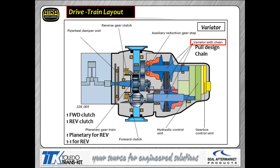To get the variator assembly out, you have two options: either take a couple of links out of the chain — which is what Audi recommends — remove the chain, then take pieces out one at a time; or press the pinion shaft out using a porta-power to get it out. The pinion shaft is pressed in place. On the right side you see the TCM in bright yellow, and the valve body in green — the TCM is mounted right under the back of the transmission and interfaces directly with the valve body.